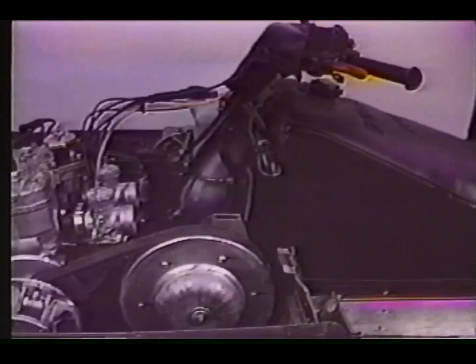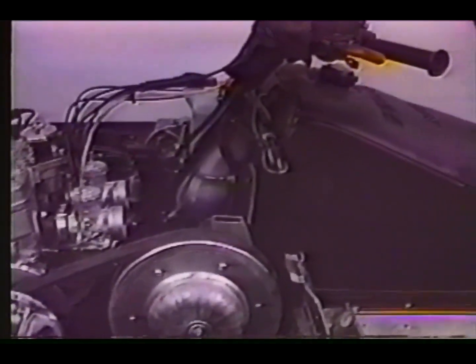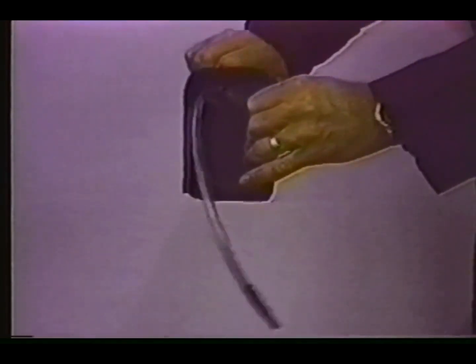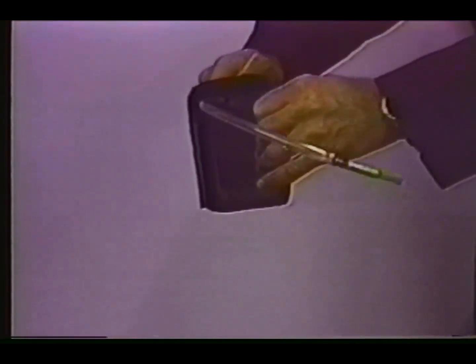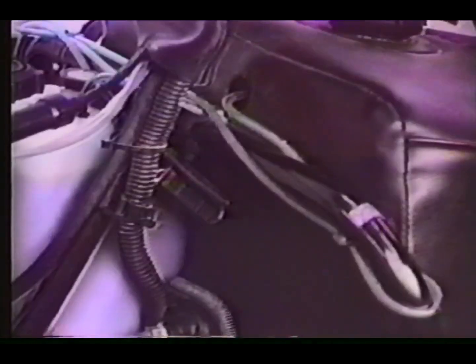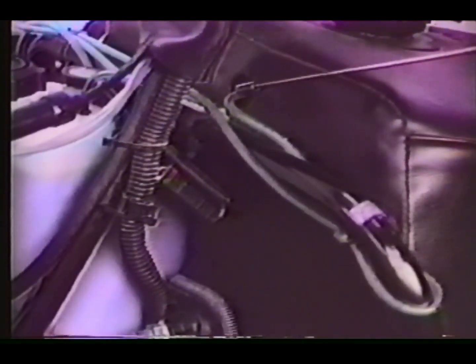When carburetor diagnosis becomes necessary, other parts of the fuel delivery system should be checked carefully before any major disassembly is performed. We'll begin by looking at the fuel tank outlet and in-tank fuel pickup hose indexing. This cutaway is representative of what can happen inside the fuel tank if the outlet fitting is threaded into the wrong position. A simple visual inspection through the fuel filler neck will tell you if the hose and the pickup are in proper place.